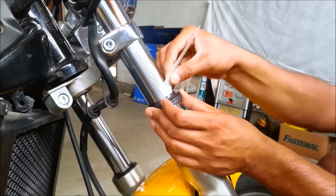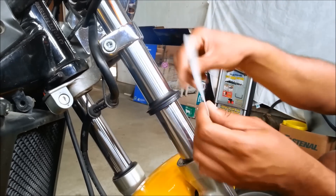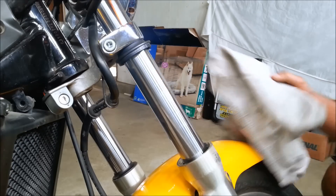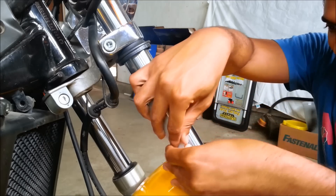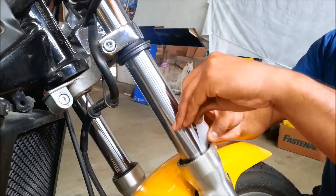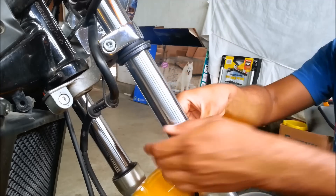It's coming out pretty clean because there isn't any dirt in there. Do this a couple of times — I like to go this way and then this way so it cleans the seal really well. Once it's cleaned, take your rag and wipe off any oil from the fork, then insert the lip right between the fork seal and the fork leg and go around — then lift the lip out and any dirt lodged in there will come out.